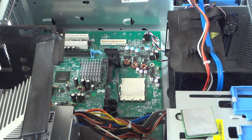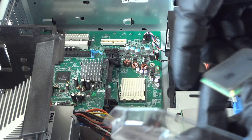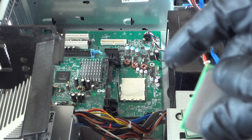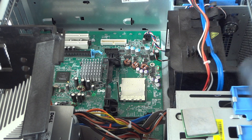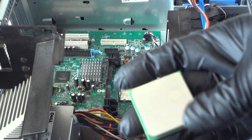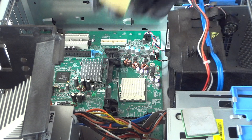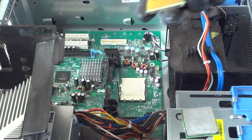I'm upgrading to dual core. The way you're gonna install it — see that gold corner right there? That goes all the way in the top right side like this. The top right corner is how you're gonna align and install the processor.